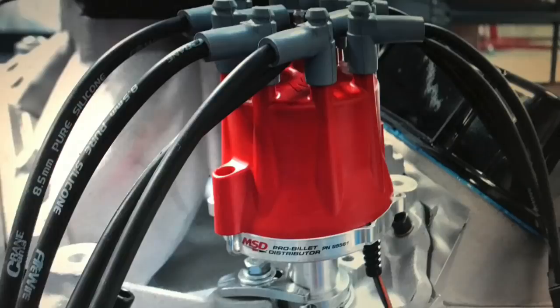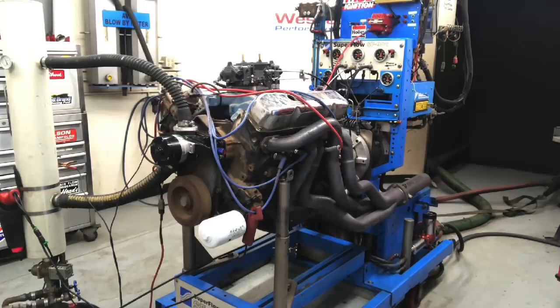Those are really the most important things — we want it to basically run smooth immediately. Once it's got some temperature, I'm just going to warm it up so the engine's running smooth. Then once it's warmed up, I'll bring the RPM up assuming everything still sounds okay. We go into the cell with a heat gun, flashlight, stethoscope, and timing light — you kind of walk around like it's your patient, babysitting it and making sure the health of the whole engine is good. No big oil leaks, no real problems. Once the engine seems okay, we check the timing and start the break-in process — that fanning of the oil back and forth — for 10 or 15 minutes. We let it idle, do a re-inspection, re-lash the valves, and then run it through another break-in cycle.